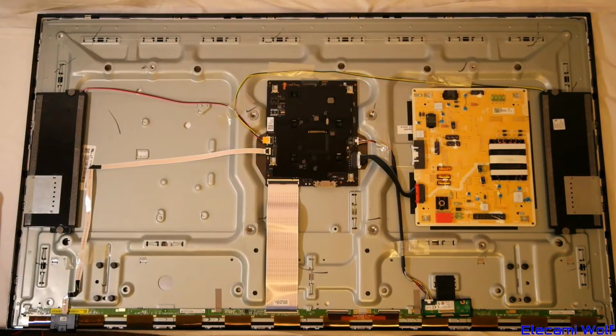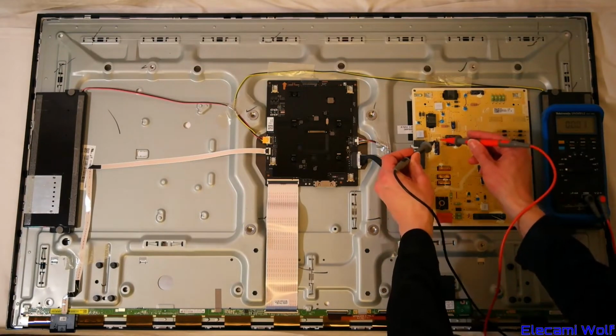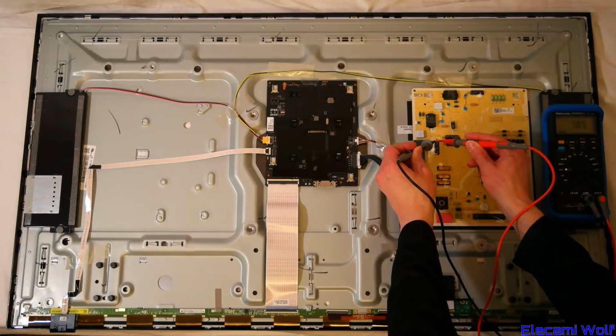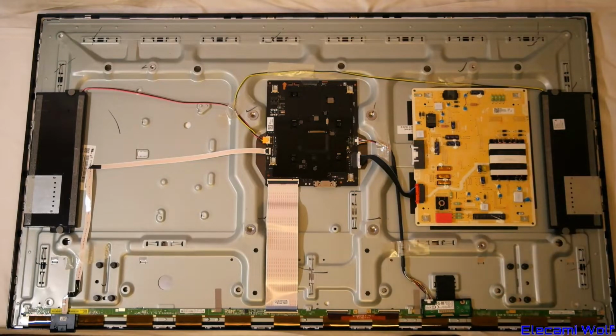Now there's the potential for high voltage on capacitors, so those should be measured before you continue, around 0 volts. And again, these ones here, 7 volts remaining, so that's alright. If it's above about 40 volts, you'd want to discharge that first. Now everything needs to be removed.